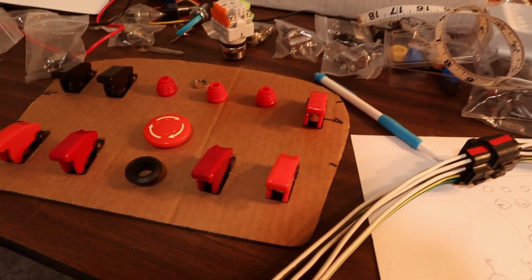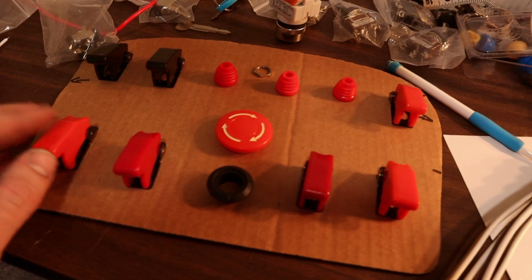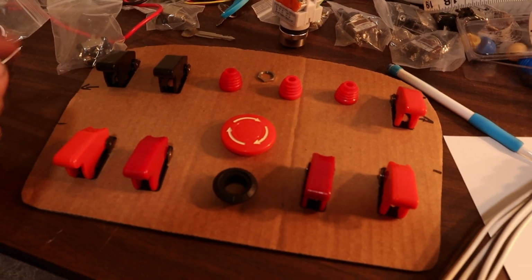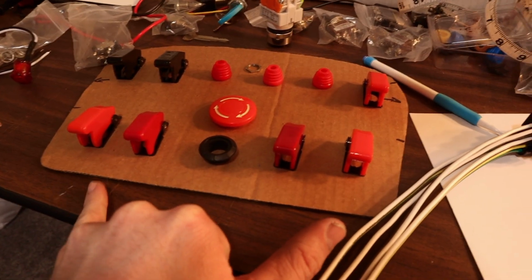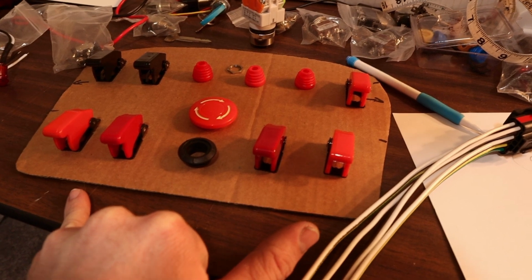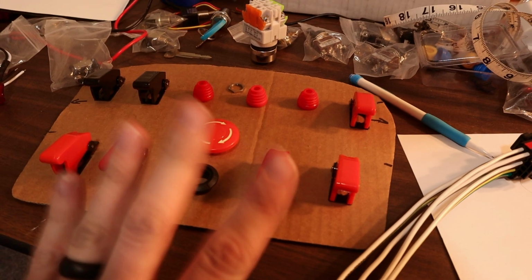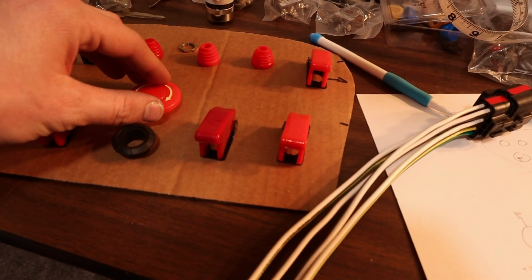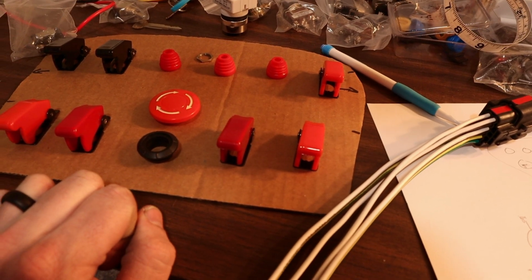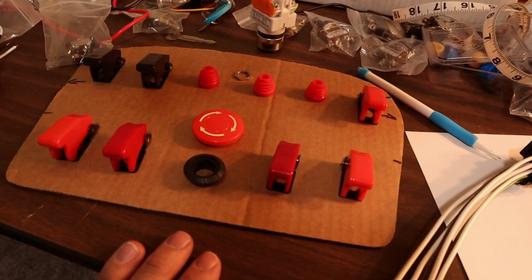So right now we're going to be running 6 along the top, 5 along the bottom, and then we're just going to kind of space them out the same. The reason for that is because you can see here the panel actually widens as it goes towards the top. Bottom of the panel is about a half an inch wider than most of the E46 ones, and the top is closer to a foot. And that's why we want to run as many toggles as we can. We could pack this full, but then this would be tight trying to run the e-stop button and all sorts of other things. So we're going to try to make sure that this is all measured out right and looks symmetrical.